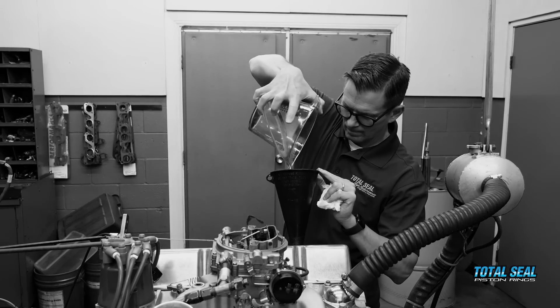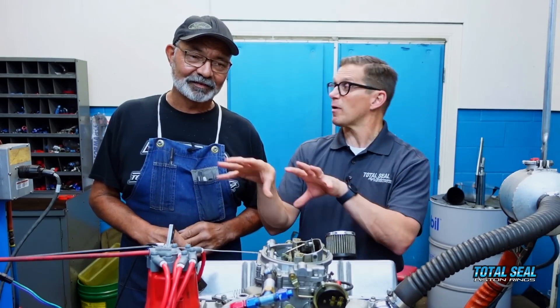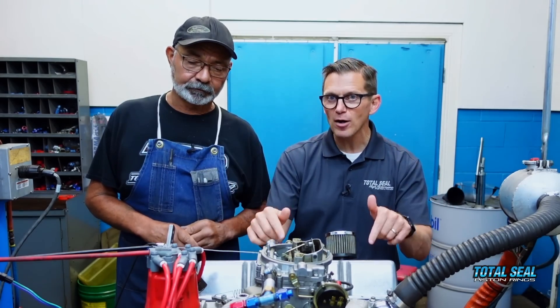Plus, with the help of the guys at Line-to-Line, we've actually tightened our piston-to-wall clearance up a little bit, so we should hopefully get a little bit better ring seal. We've got oil in the engine — the right amount, the right type of oil. We actually have videos in the description about the proper break-in procedure, which we're about to go through — the same procedure we always do. We also have a link about break-in oils. We've got BR-40 in here right now, and there's a reason we use BR-40. So we won't go through all those details now. Hopefully in a minute we'll be able to show you guys some results of what actually happens when you do all the right stuff.